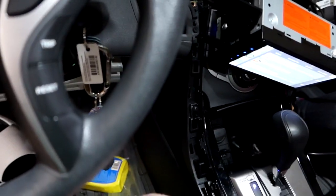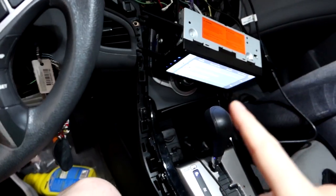With that cable, Android Auto and everything popped right up. We also found out you do have to hook up the parking brake wire, because when I connected Android Auto it said 'please put your car in park' — it waits for that signal before allowing you to use Android Auto.